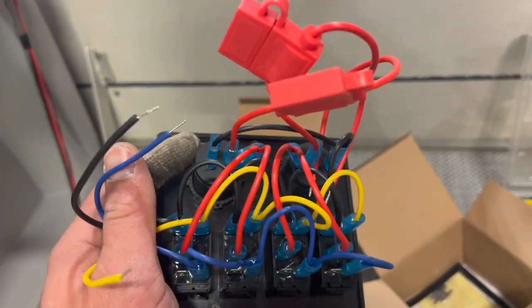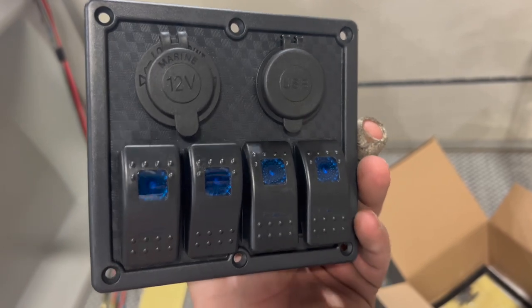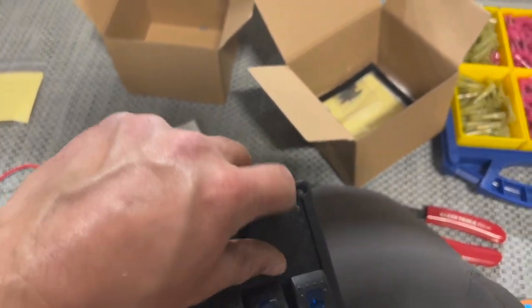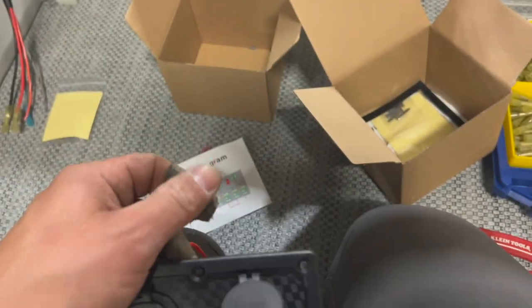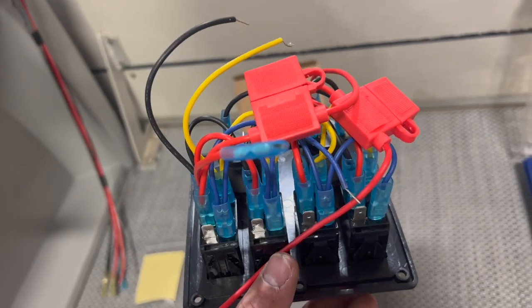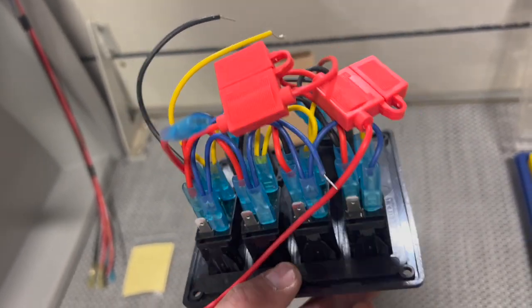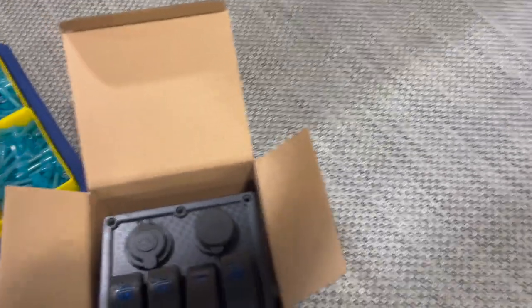I don't want my lights on all the time. The way this comes, you have those red power wires, a yellow that's a ground for the dash lights, blue is power for the dash lights, and black is your main ground. I tested this on a battery and I've rearranged mine — I don't want all these blue indicator lights on all the time, I only want them to come on when I flip the switch on. Also, if you hook straight power to this the way it's wired, this little USB will light up and stay on all the time. I'm going to rearrange things, so I'm omitting the yellow ground and that blue wire.